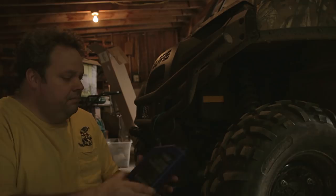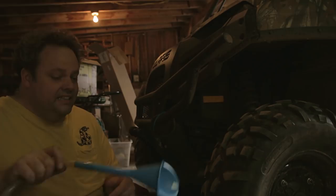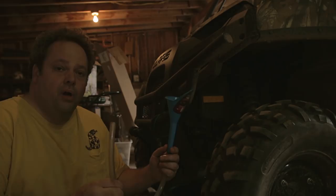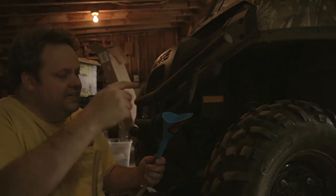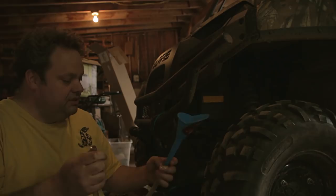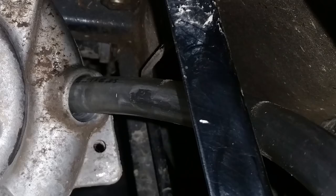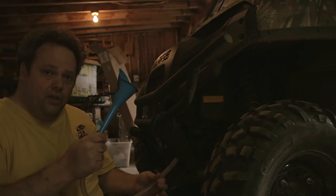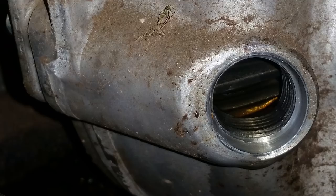To do that, I recommend you put together a little contraption — it's a funnel, just a regular household funnel from your hardware store. Get one with a nice lip on it. Then get some transparent hose — about a half-inch — that fits over the end of the funnel. Get a nice length of it and you can insert that and work it around the frame and into the fill opening. Use transparent hose so you can see the fluid as it goes down, and when it starts backing up into the hose, you know you've filled it up. Fill it until it's level full so you can see it in the threads, then put the plug back in and you're done.